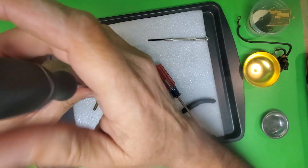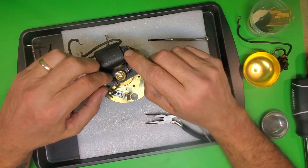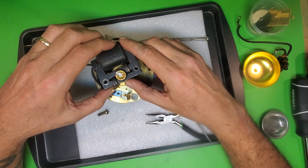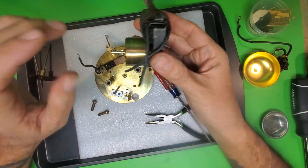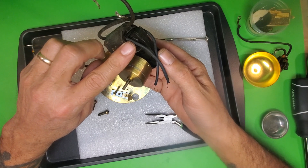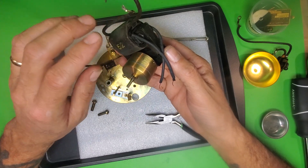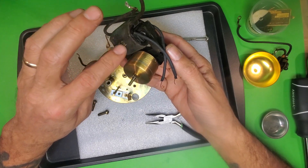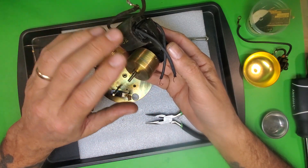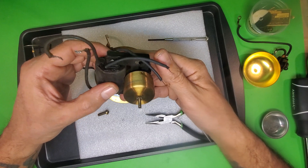What I've found — and this is unique to the Electro Alarm as far as I know — is that the Clinton Vernon, which is less costly to buy secondhand, also has a coil with two wires coming off of it for a lighted dial. In an emergency, if you can get your hands on one of those and your Electro Alarm coil won't work, if you just extend these two wires by a couple of inches, you can use one out of a Vernon or a Clinton.